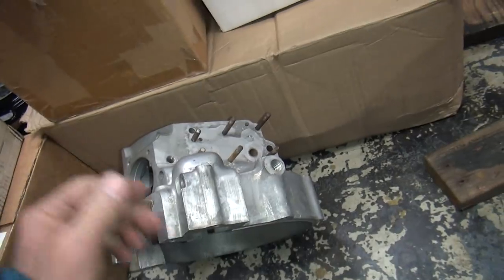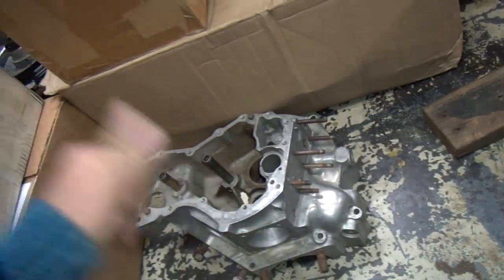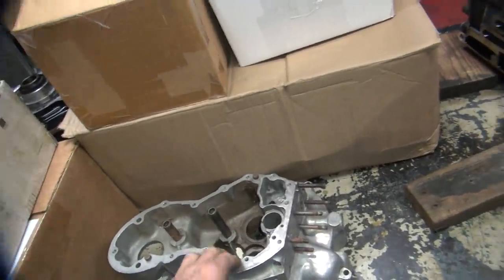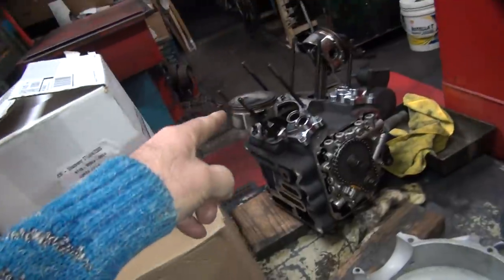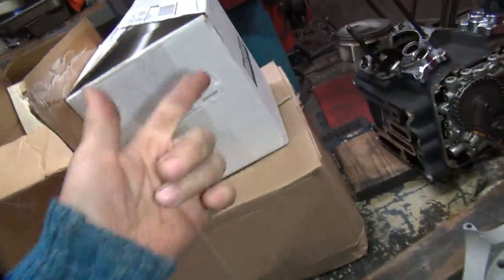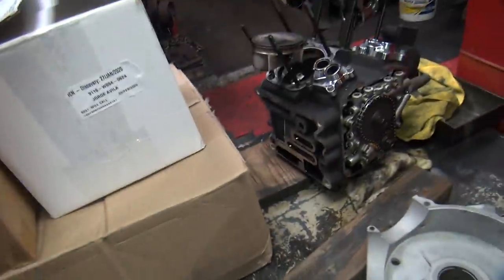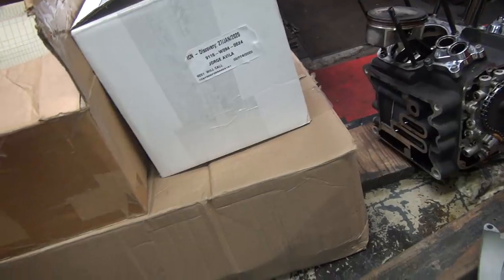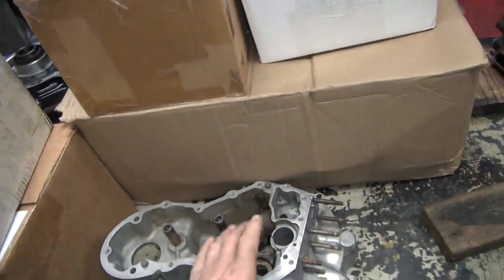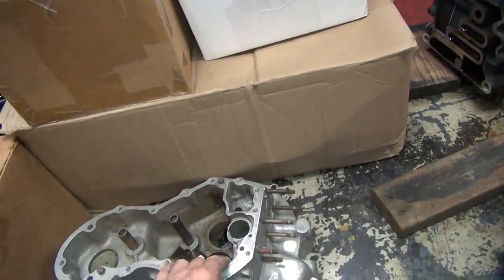Everything you do to these motors that gives you more pressure returns and bigger breather hoses makes them run better, because that means the crankcase is not under pressure. Now if you have oil pressure sucked into your air cleaner, that's how the 92 and later Evo motors are - all the oil instead of blowing on the ground blows inside your motor, goes right inside the combustion chamber, which causes detonation and puts holes in pistons. It also makes the piston oily and crappy. On the old motors, the tube went to the ground so we didn't care about the air cleaner - we liked a clean air cleaner.